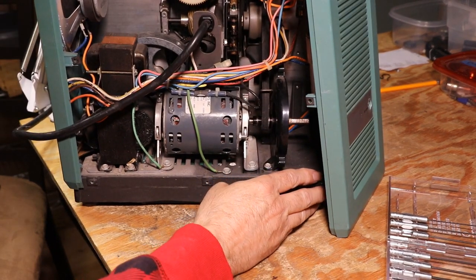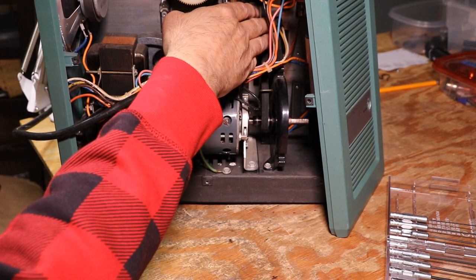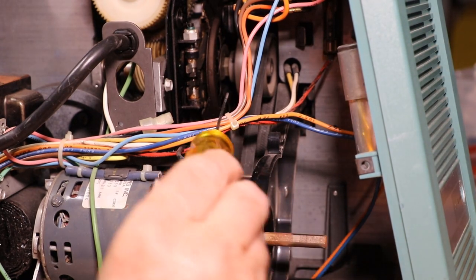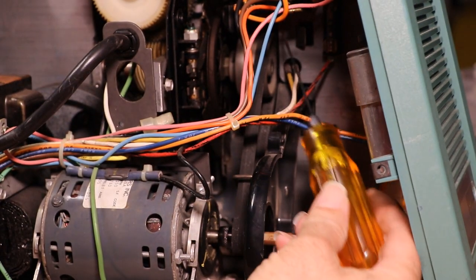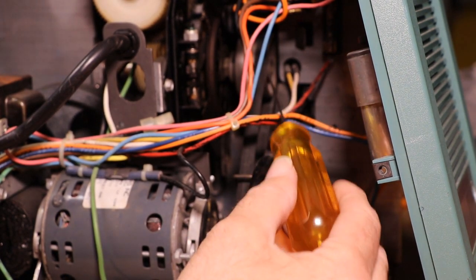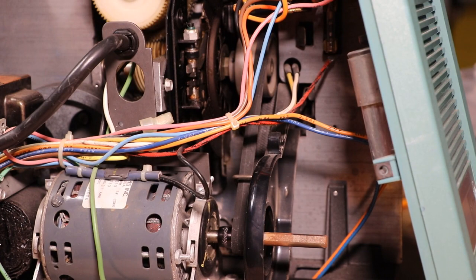So what I'm going to do — it's unplugged — I'm going to slip it off the top first, and it's kind of a bugger. There's a very small clearance up in there. I'm going to lower my tripod so you can see a little better. We're going to take this belt off on the top first — take it off this shutter pulley. It has to get between this gap, so it's going to slip off and get stuck in that little gap. You just have to work it off. Try not to break anything — I usually use two hands.